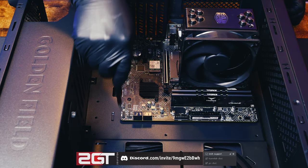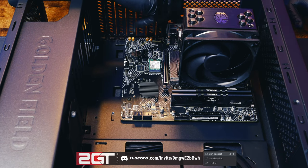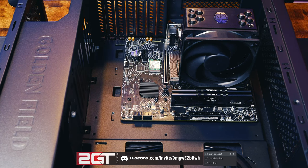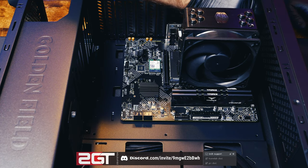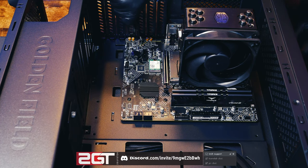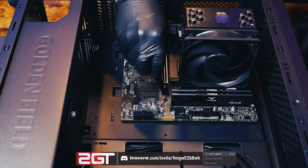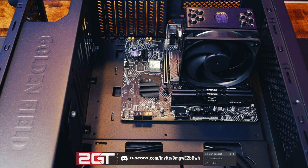This M-ATX board has three screws across the top-middle and three across the bottom — six total. Side note: a lightly magnetized screwdriver tip is really nice for this and won't damage anything. We don't live in a world where a magnetic screwdriver can destroy a floppy disk anymore. Once all screws are in, tighten everything down. Don't screw things down so hard you hear cracking or popping — a respectable amount of tension is good, but not so much that you cause damage. Motherboard is mounted in the case.